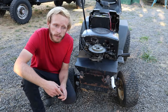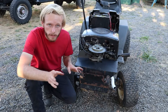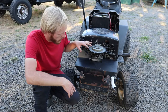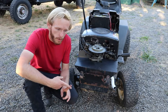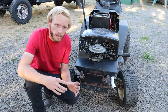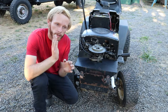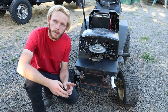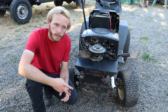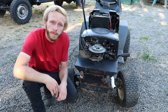Alrighty, ladies and gentlemen. So in the next video, the engine is done as far as we're concerned. Obviously, I'll do a finale mowing, doing something or showing it off here. But next video, this will all be done. Hood will be on it. We got to do the belt to the transmission, which is oversized and really loose, and it's causing it to slip off and do some weird stuff. It's also not quite right. It's kind of angled funky. And then we need to do a drive pulley off the electric clutch to the deck, and we also need to service the deck. And then we also need a tire. And other than that, this is gonna be ready to go.